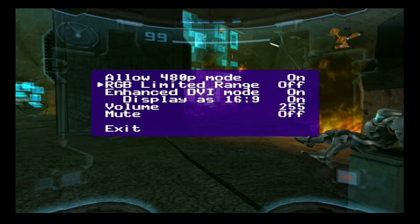Enhanced DVI mode is something I'm not familiar with, but it's to do with audio traveling through this adapter — I haven't experienced anything different with it on or off. With that off, you could probably use the analog output and connect that to a stereo system or anything of your preference. Display as 16 by 9 won't change the image to widescreen, but it will tell your display that the signal output is to be shown as a 16 by 9 aspect ratio. This can help some displays or scalers to respect the settings in case you have any problems. You also have volume settings so you can boost or decrease that with just the remote, or even just mute it.